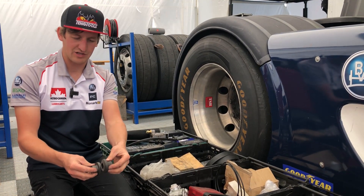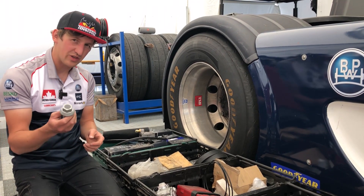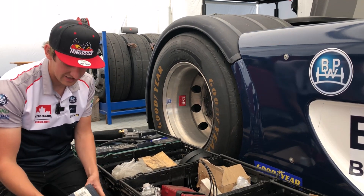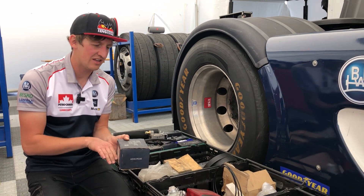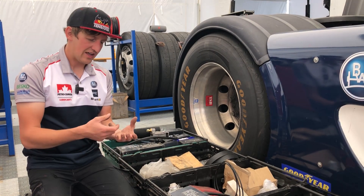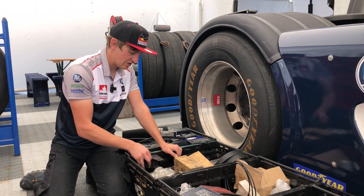These are PE's own wheel nuts, specially designed for truck racing. In the past we ran standard ones, and when two trucks came together at a hundred miles an hour, it would fire the trucks up two meters in the air. With these new nuts, the idea is that they deflect each other for safety reasons. Some drivers would also use the wheel nuts to eat the back tire of the truck ahead to slow them down and damage the tire. We carry the front wheel nuts too, as sometimes the face gets too badly damaged to use, or a sharp edge can cut your hands when tightening them.